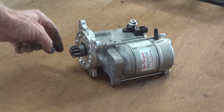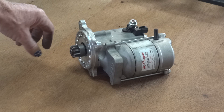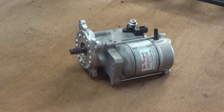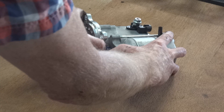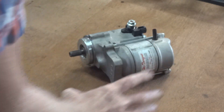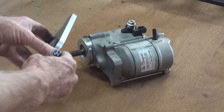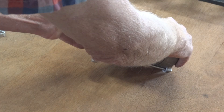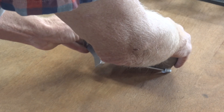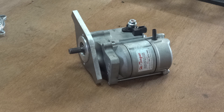We'll need to use that to build a drive shaft to reach to the pinion that's going to actually do the work. So that's come off. I've got this little bit of plate made up, which goes on instead. I'll show you how that works to mount the starter motor halfway down the side of the engine, a reasonable distance from the ring gear.